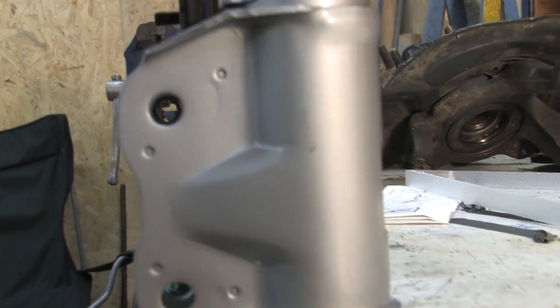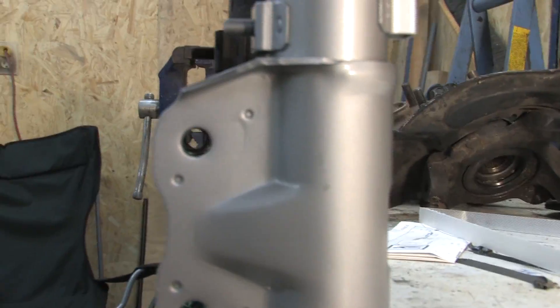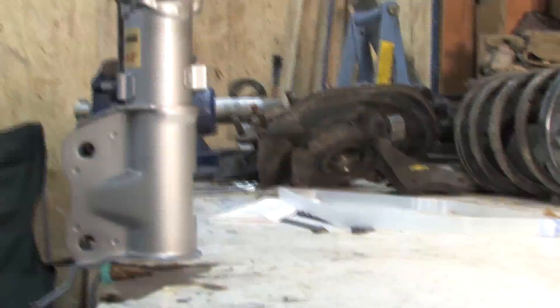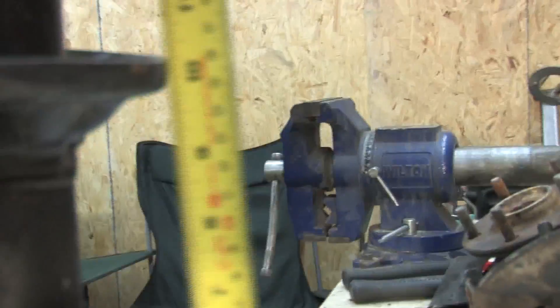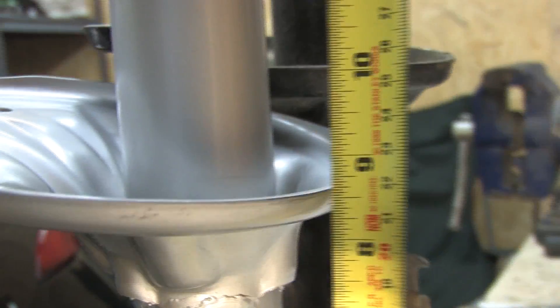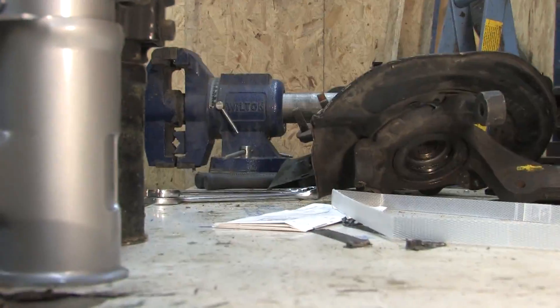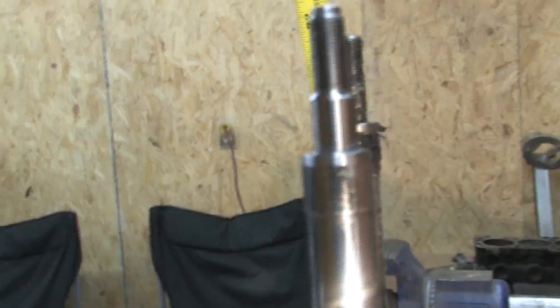At first glance, you'll notice that both of the bolt holes line up exactly the same on both struts — they're the same diameter as OE Turbo Eclipse struts — but they only have two significant differences. The Colt strut's lower spring perch is 8 and 7/8 inches when stood up like this, and the Turbo Eclipse perch is 10 and 1/4 inches. That means you can achieve a 1 and 3/8 inch drop with 100% factory parts on a 1G all-wheel drive DSM simply by swapping your stock struts with a set for an 89-92 Mirage.